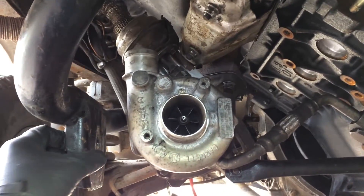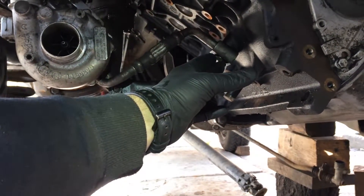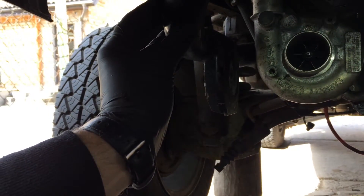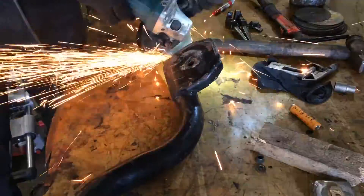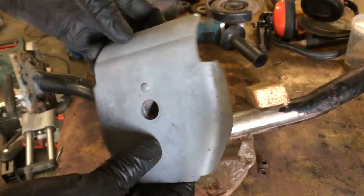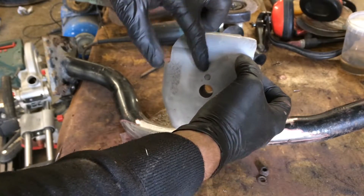I got the whole engine hung back in place with the gearbox, and now I'm going to fabricate the hinge. I want to move this bracket to this place so it's going to be situated something like here. I've cleaned that part — maybe make a cut here, here, and here.